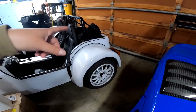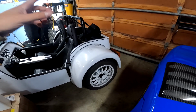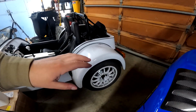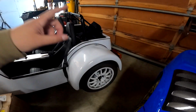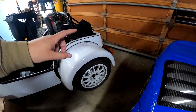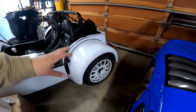And so one of the things that I didn't turn the camera on for was I realized that I had set up the rear brakes incorrectly, and more or less they just weren't functioning. All the braking I had was actually out of the front wheels. The rear uses Miata NB. So this is second generation Miata sport discs, which are a little bit larger, sport calipers, etc.